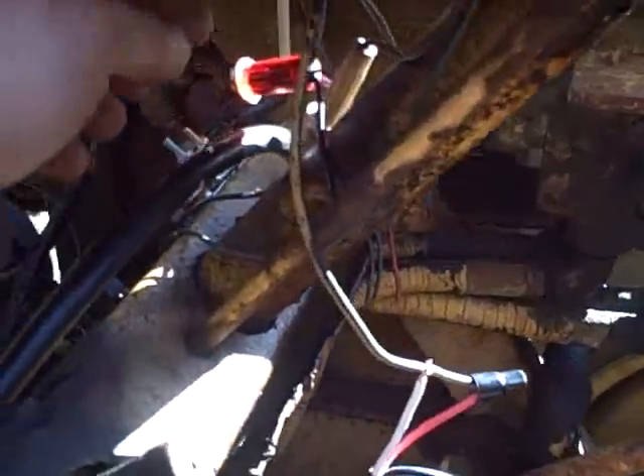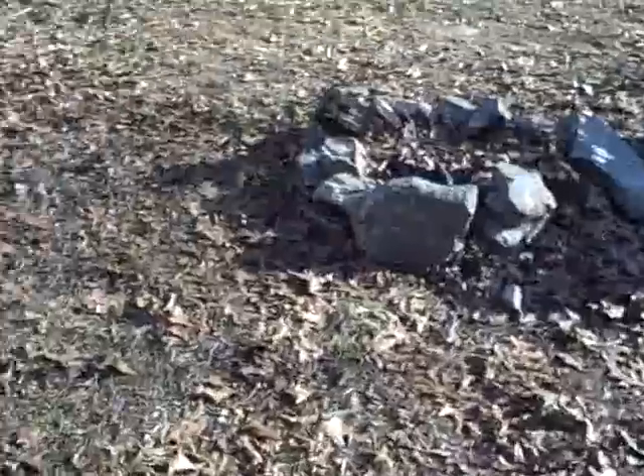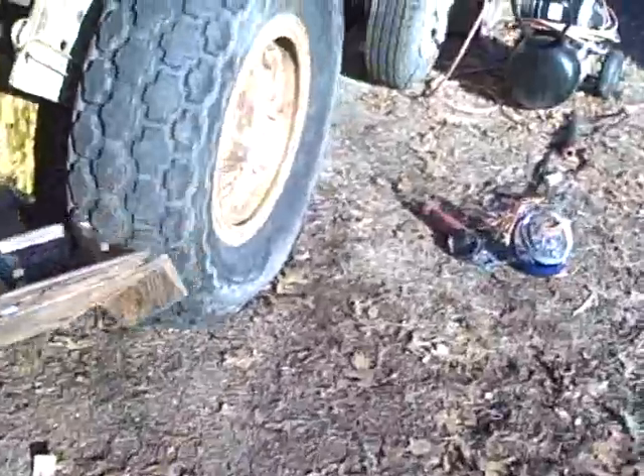So what I can do now is reconnect this wire to my idiot light — I bet the idiot light will not light up. I've now reconnected the idiot light and it is out. The reason the idiot light went out is because the alternator is now producing voltage.